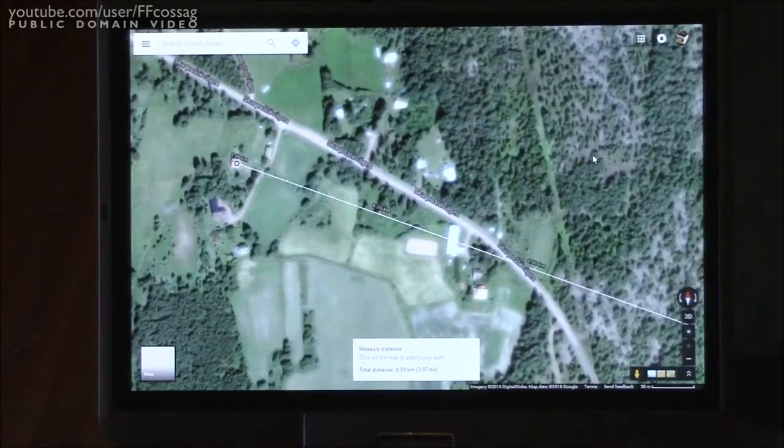In order to do this, I just used a coverage map provided by my telecom provider in combination with Google Maps in order to map out where the nearest 4G tower is, and as such be able to plot a line of sight directly from my house to the tower. By then just placing my laptop underneath the antenna with a line drawn on the screen, I could easily aim the antenna in exactly the way I wanted it to be.